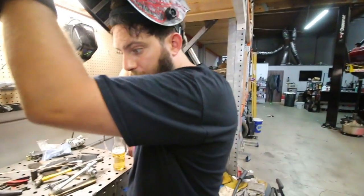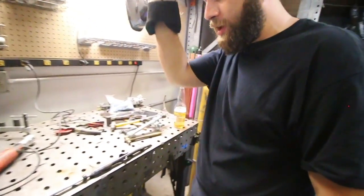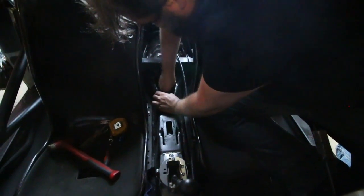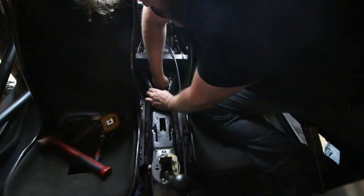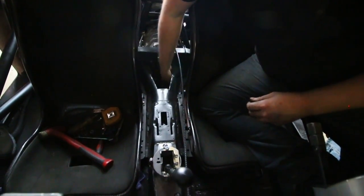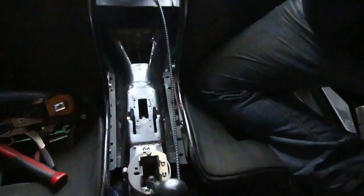Should stop popping out a second when we're trying to put it in under power, which is why it sounded like it was so. Yeah, it's not the gearing that's the problem. It's we didn't have most of our gears most of the time. So Sam's put it in reverse on the transmission side, and it's in reverse on the shifter side. It's going to tighten up the linkage, and that's been all of the success that we've had so far with adjusting it.